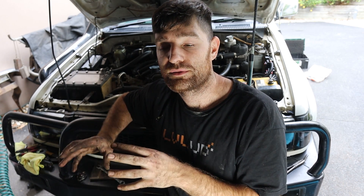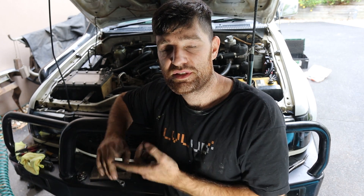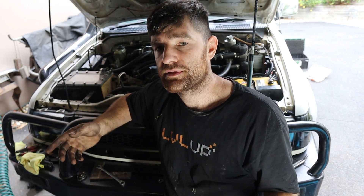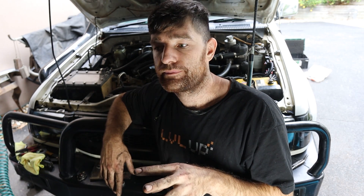Originally when I rebuilt this engine — if you haven't seen those videos, check them out — I had it clocked wrong, and I was throwing an error code, which was number 41 or 14. I went problem solving for both. One of them was a TPS code, the other one was a timing code. I read it as a TPS code first. There weren't any issues with TPS, so then I went problem solving for 41 because maybe I was reading it wrong — it was four blinks and then one, instead of one then four.